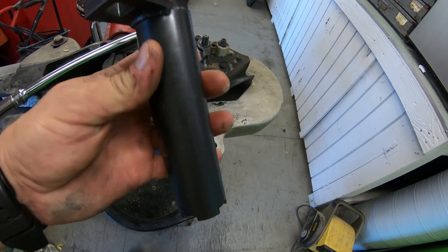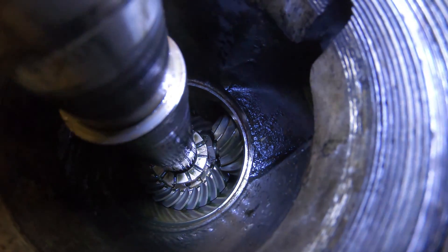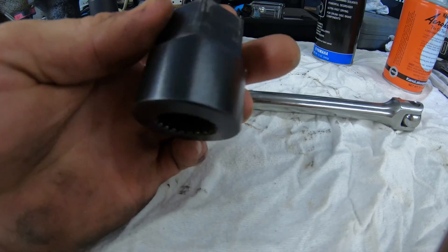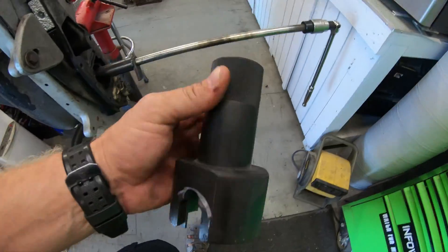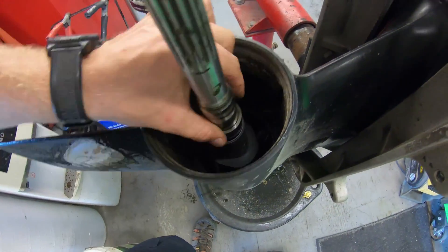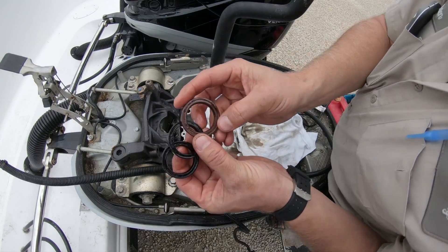This is the tool we use to remove the nut. With that broken free, we can work on removing the pinion nut which is on the bottom of the drive shaft. You can use a 1-1/8 inch wrench to hold the nut, then you'll want to have the drive shaft spline holder to get it off. Without that tool you'll be stuck using a pipe wrench or channel locks — just make sure you stay away from the top section of the drive shaft because there are o-rings and seals that go into the oil pan on the engine.